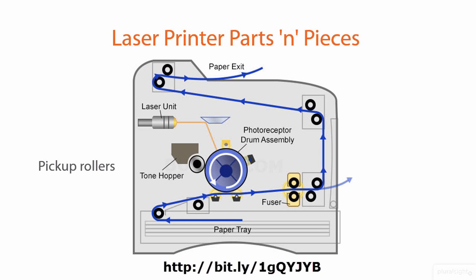The laser printer has a series of rollers, some of which are responsible for picking up and pulling the paper through the rest of the process. Many laser printers will have an extension, normally at the bottom of the printer above the paper tray, that handles duplexing. In this gradual movement towards the paperless office, the first step is to reduce printed output, and you could take a 100-page printout and make it 50 pages if you turn on duplexing — so it's a good idea.